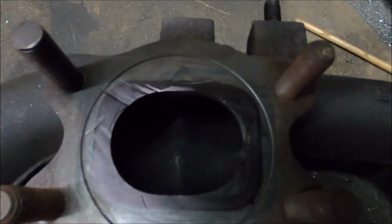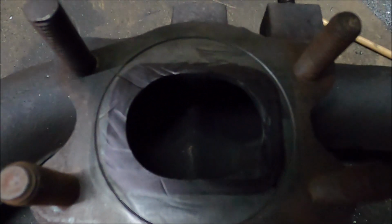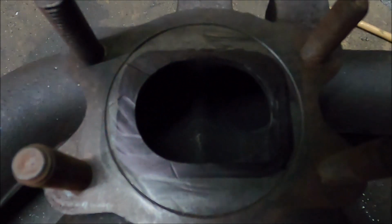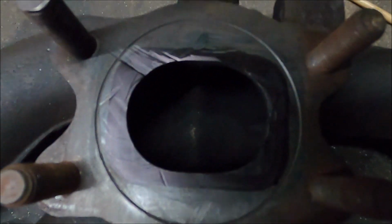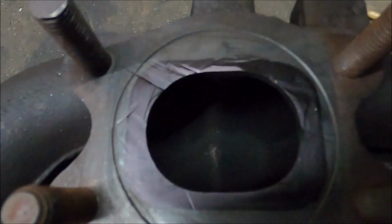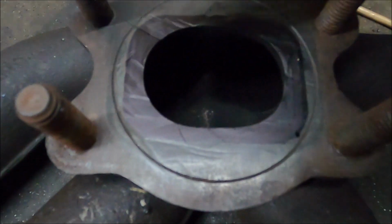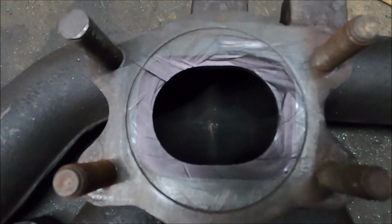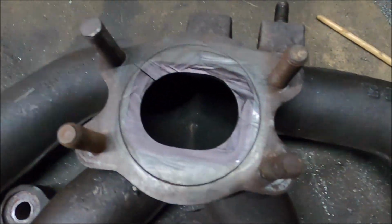So in essence, this isn't a problem, it being a big step larger, but in other ways it is, because it's quite a small hole for that gas to get out of. More to the point, you can see the collector of the 4 cylinders in there, look, and obviously they all have to collide and then squeeze through this. Smaller to larger isn't always good, because if it's too small, it's bad.